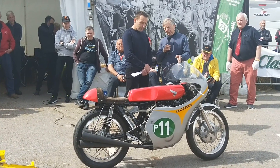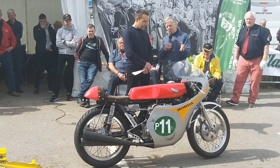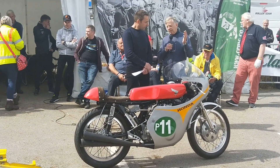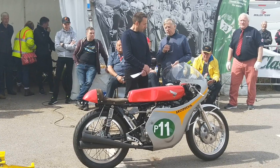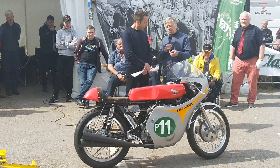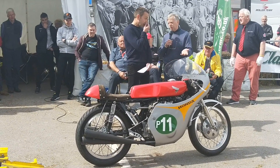So when I got the bike, I stripped it down, remade a new crank with 120-degree throws on it, cut several cams up, made vernier couplings, and made it into the three-cylinder — but it's a 120 crank, so it fires every 240 degrees.